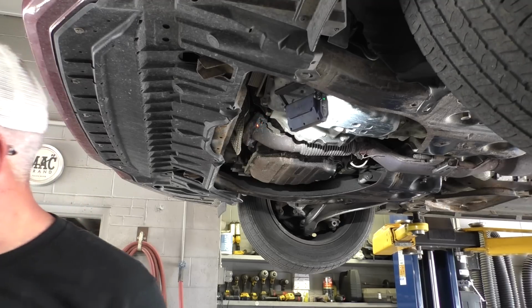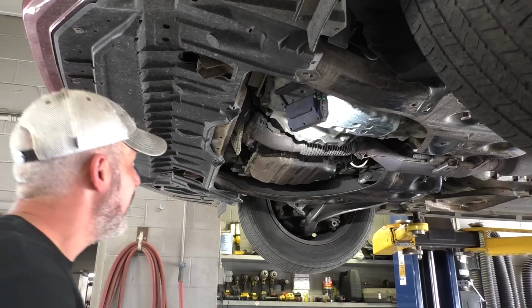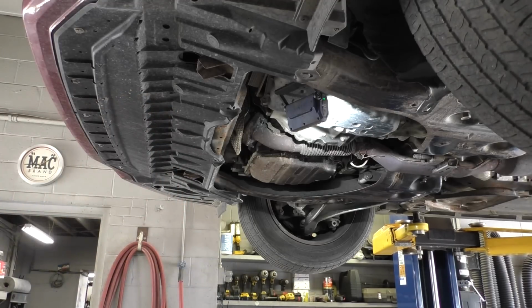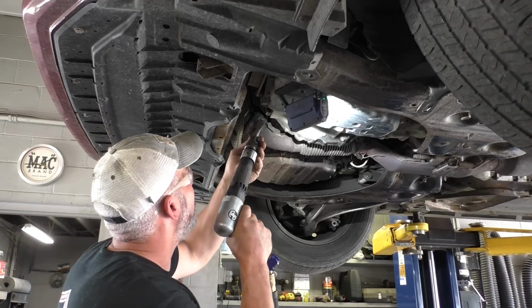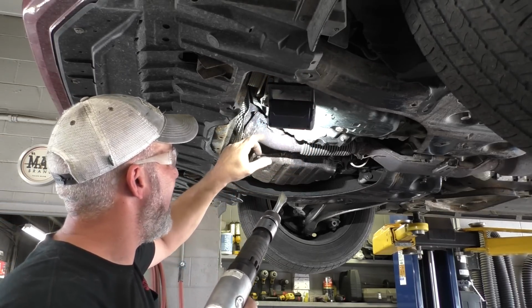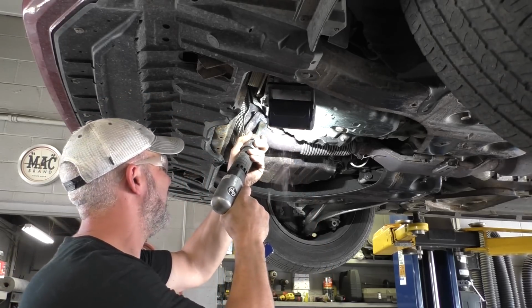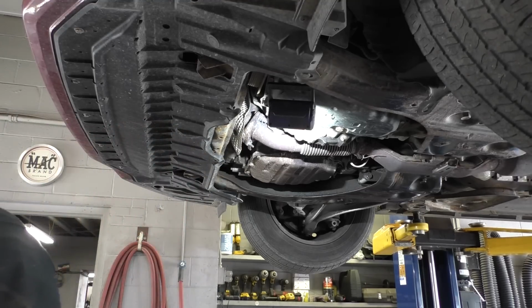Now you see in that area there, I was screwing around a lot more, up on the flange of the nut. Now that one I just did the old one-sided slitter. They call it. It's a classic move. Sometimes we do that where we just brush off one side of it, and then you come around. For example, like this one here, I'll enhance you on it in a minute. It's hard to get to the back side of it with the torch. So you just do the old one-sided slitter, and then you spin it around where you can get on the other side.